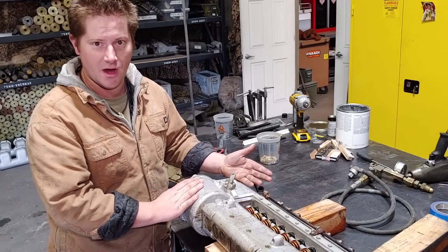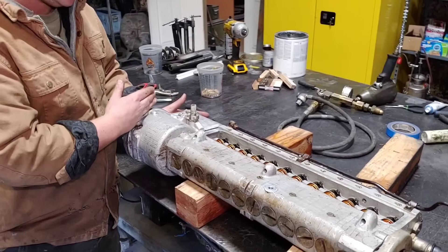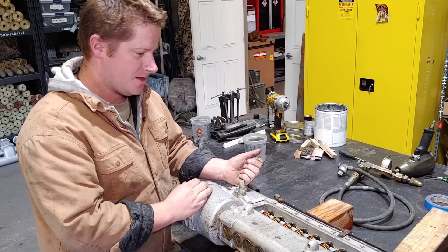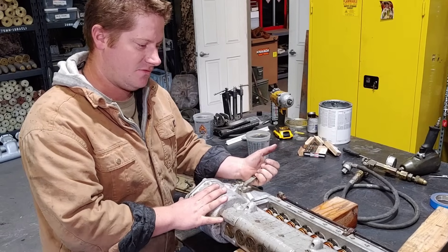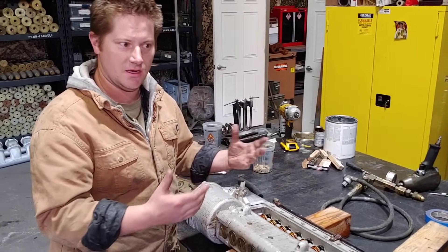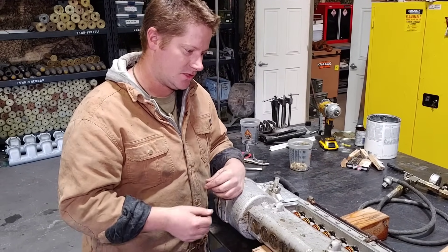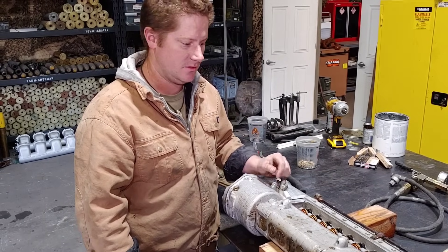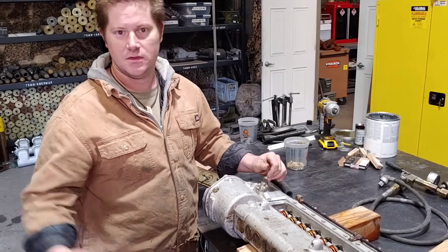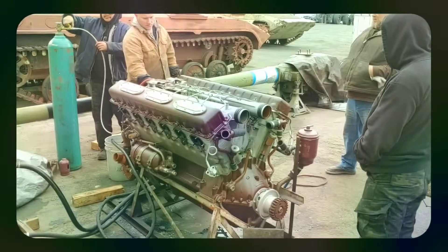It just sat for so long — dry. All we had to do was pull this rear cover plate, get some lubrication on there, get some movement through it, and we freed up this arm. So in that last section of the video all our fuel was clear, we had good fuel, but the issue was the tank was just thinking that it was off. Regardless of how much we were turning it over, there was no fuel actually getting pulled out of the fuel valve. Now that we have this freed up, we'll reinstall this and try it again.